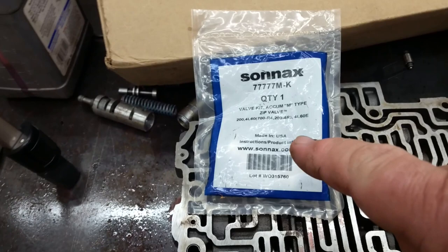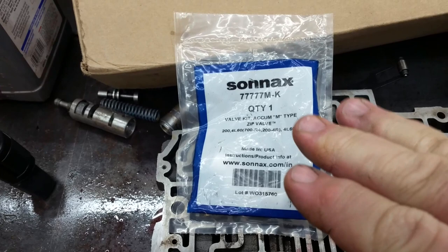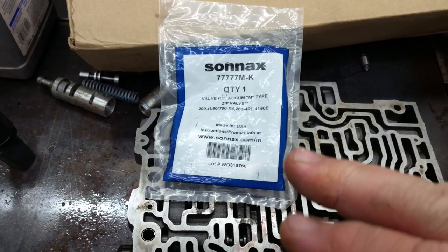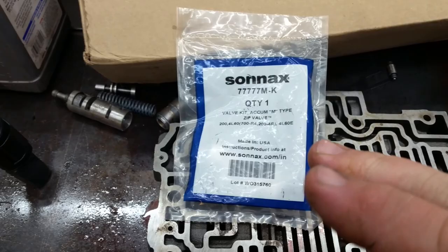I'm kind of guessing that's what L2theW has got in his Project Z28. He said he's got the G92 axle option, which they call a performance axle, which more than likely is either a 308 or a 323. It won't be a 273.